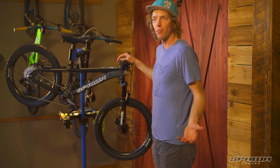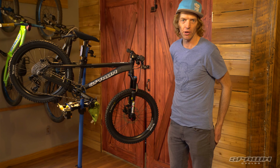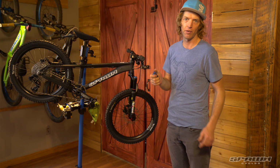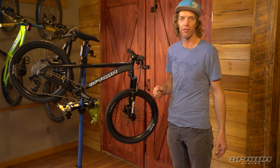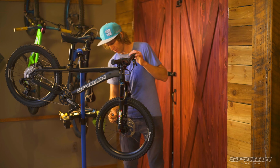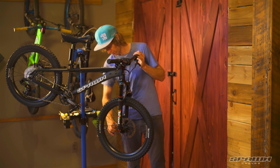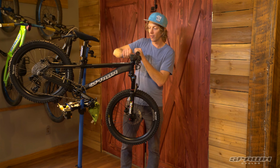Great, well that's the bike assembled. Next thing to do is an overall bolt check. Just walking around the bike with your Allen wrench set and just ensuring that everything that has tooling is snug. We're not trying to tighten things, we're just making sure that they are in fact tight, which they should be. So we've done the front caliper. With the 6 mil, we've done the stem.